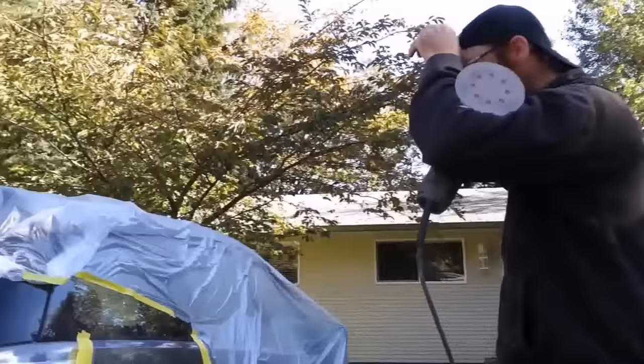Just do another skim coat over it, and yep. Just gotta wait for it to dry. And then skim coat it, and then should be onto the putty coat. Okay, two more low spots. One right here, and one right there. Okay, so now we're on to coat number three, right? Yep.